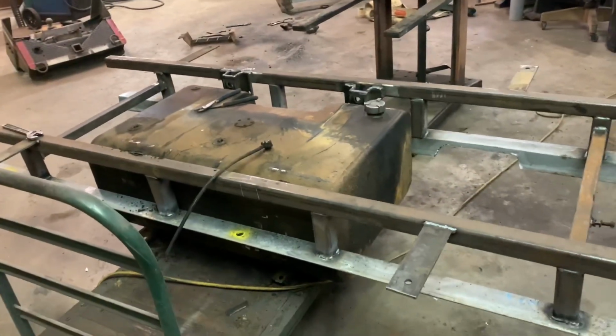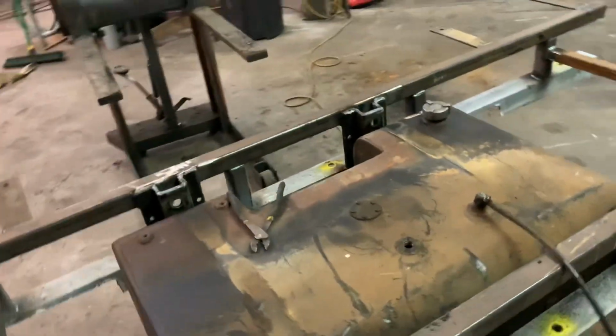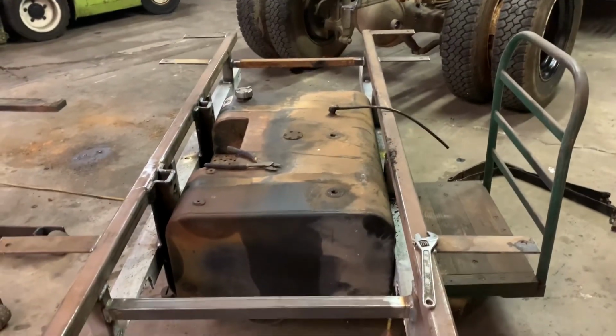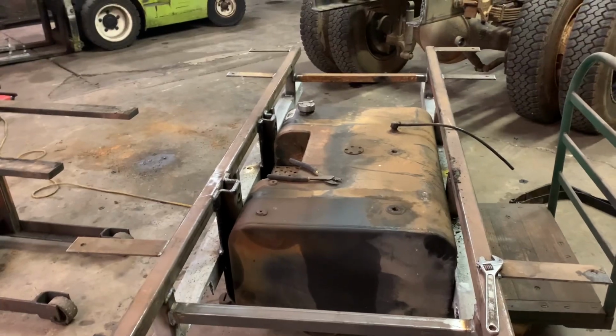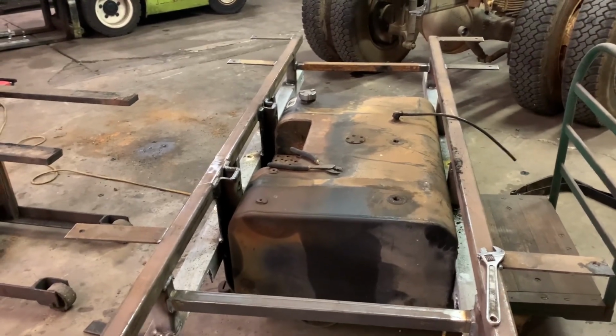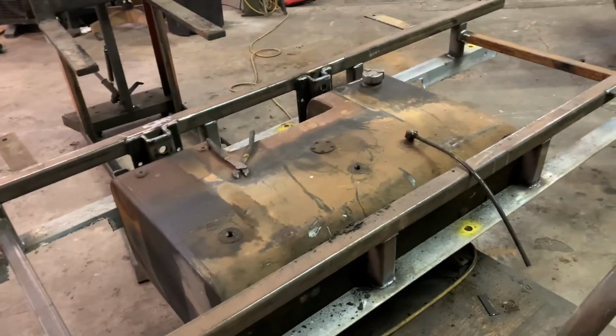So that's really straightforward. After that, it's just extending fuel lines, which is relatively low pressure, so I can just use some old copper hose or something, or if I want to have new lines made, I can have new lines made. It's just diesel, low pressure diesel. So let's get this thing shoved out, I guess, and start pressure washing, paint it up.